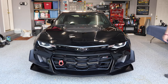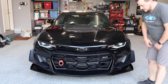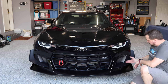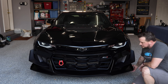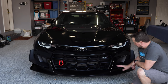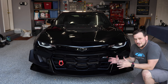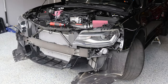And there you have it — ZL1 1LE front end conversion done on this 2023 ZL1. Just to recap: it's a different upper grille, a different lower grille, the front splitter is different, the dive planes are added, the side intakes are different, the daytime running lights are gone, we've got end caps on the splitters as well, a whole lot more airflow, a more aggressive lower grille, and a lot more downforce. All we've got to do now is test her out at the track — we'll be doing that October 14th and 15th at Road America. Wish us some good weather, and we will see you in the next video.